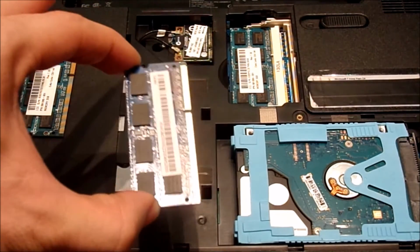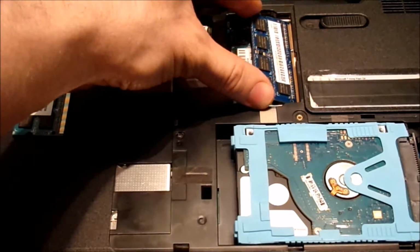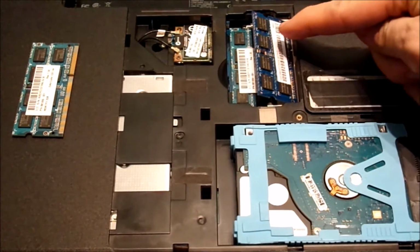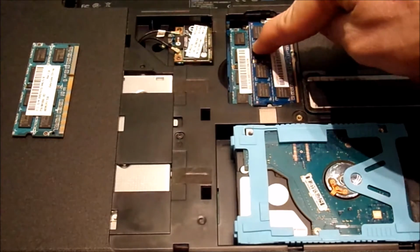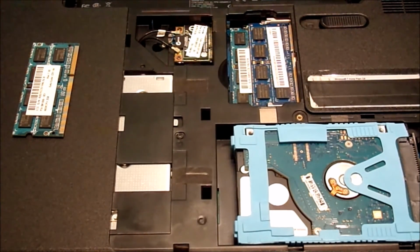This is DDR3, okay? This is compatible with this computer. Make sure you get it in that slot. You can see, I'm going to use my finger, and that's going to hit this little lip here, and push it down very gently. Now, here we have the biggest problem. It's called mixed RAM. It means the colors are not matched, but that's okay. This is going to boot fine, and I'm going to show you how this computer boots up.